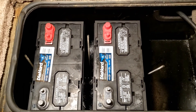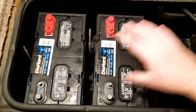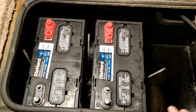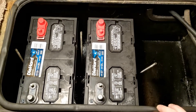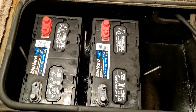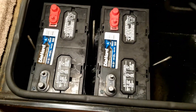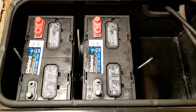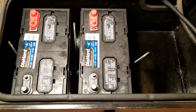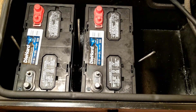They should be more than enough for us. The other thing I am going to do once everything is wired - the negative that feeds the coach will be here - I'm probably going to put a cutoff switch there. It does have one up in the dash and it does work, but it would be nice to just isolate these batteries totally from any wiring here. So in case it sets for a few weeks, I'll just be able to lift this cover up, go in here, turn the knob, and shut them off. That should improve the battery life some.